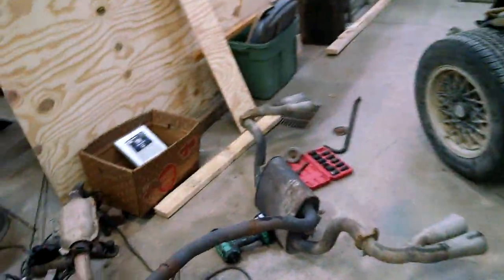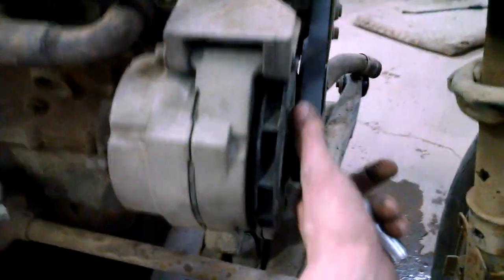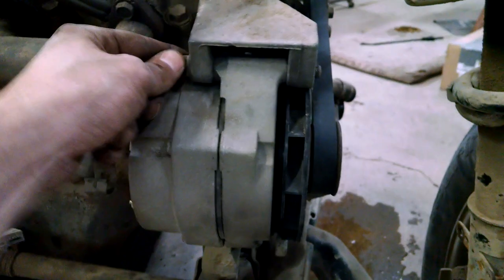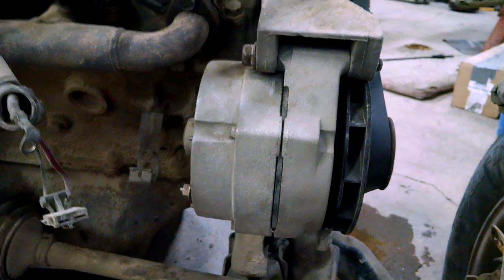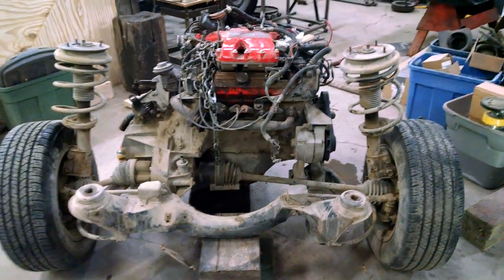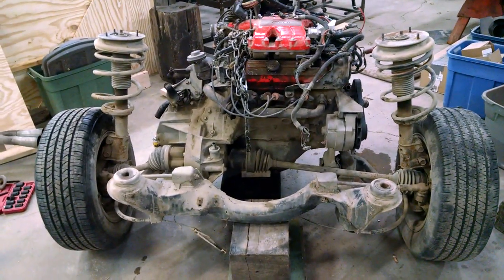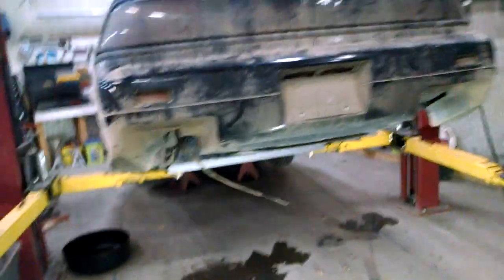He's also going to be welding my exhaust. I picked up some more wire for that. I was able to figure out my alternator — I could never get my belt tight enough and I didn't know why. Well, it's because this piece right here was not through where it needed to be. It was a bad deal, but I lucked out. I tightened it up and it's no longer going to squeal. So to all the neighbors and everyone at the school — sorry, but it's fixed now.